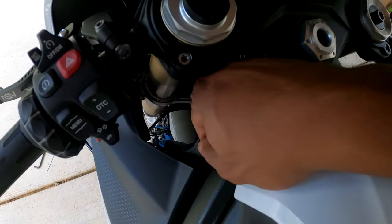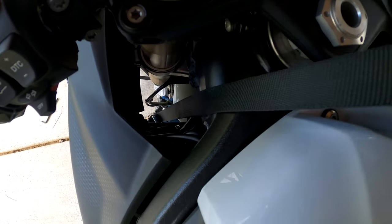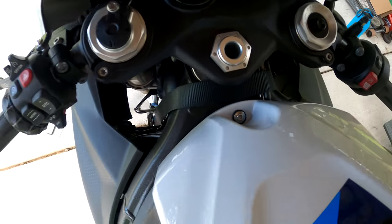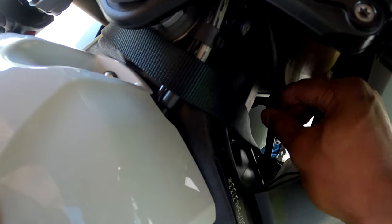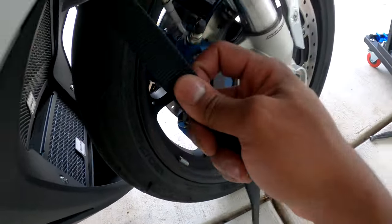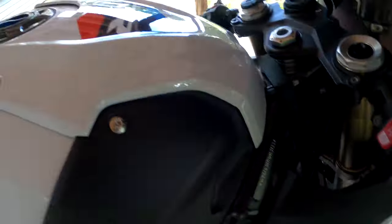As you can see, it's coming up through here and it's a little bit loose down there — I'm going to tighten that in a second. You want to route it around the front of the triple tree, around the brake lines, and then down between the frame and the other side of the wheel. Make sure everything's straight and nothing's kinked or twisted.